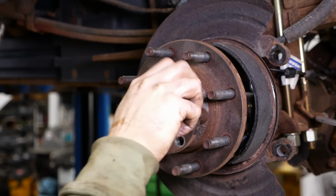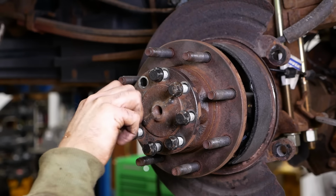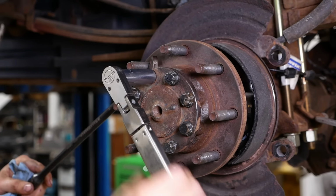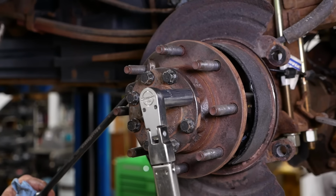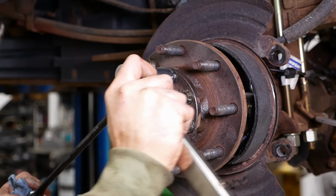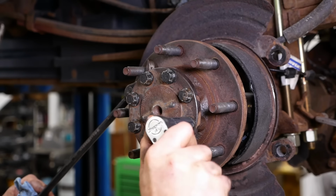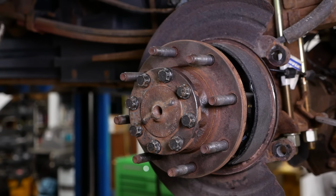Install these bolts with some new Loctite. And we're missing one. All right, I'll have to find that bolt and then look up a torque spec for those. Book says 37 foot-pounds. That does not seem very tight. In a crisscross pattern. Yeah, we got them tighter than that with the impact. Okay, break time.